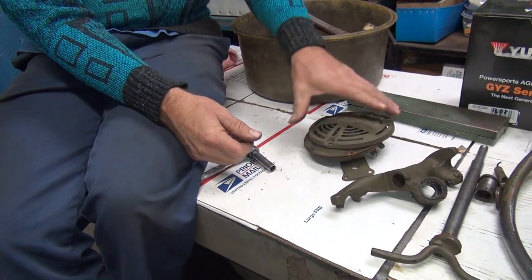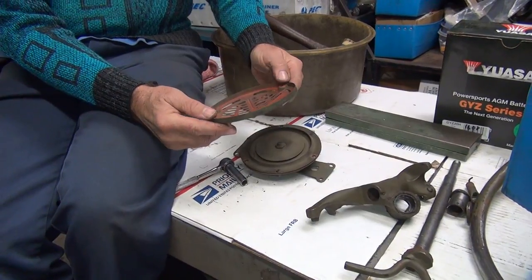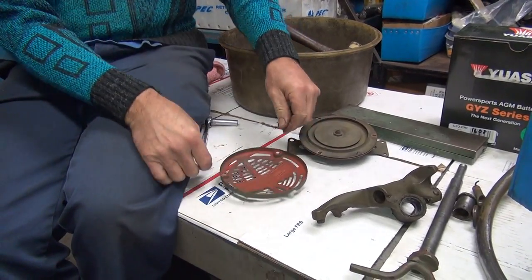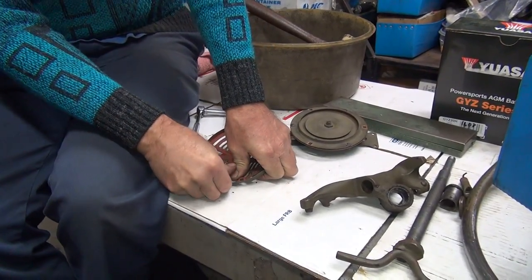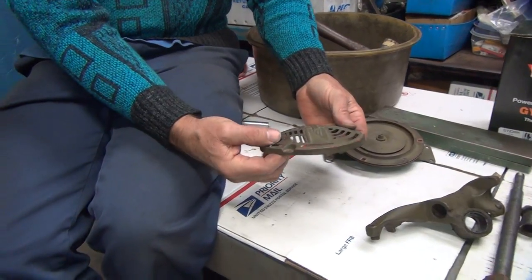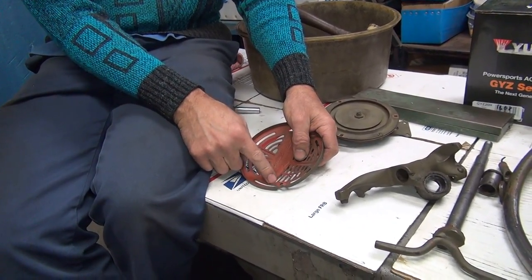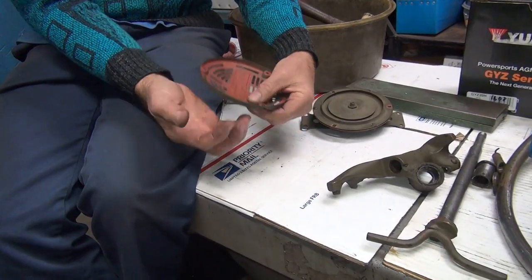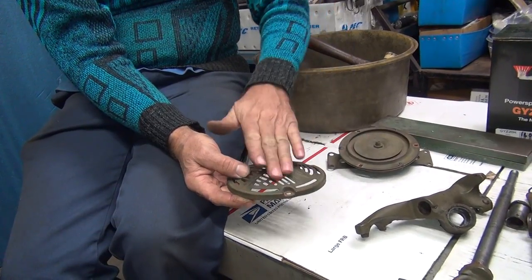On your bike this might take a cover on it. The WLA has a bullseye-style cover, so this is your earlier 30-style cover. This is bent so it needs to be straightened — you need special tools for that. I imagine that thing's brass? Yep. You need to take a light little mallet and hit it against something softer, and just lightly tap this out evenly. You don't want to be hard enough that you're going to collapse this — something really soft, like foam rubber, to spread the load and knock the whole surface down to smooth it out.